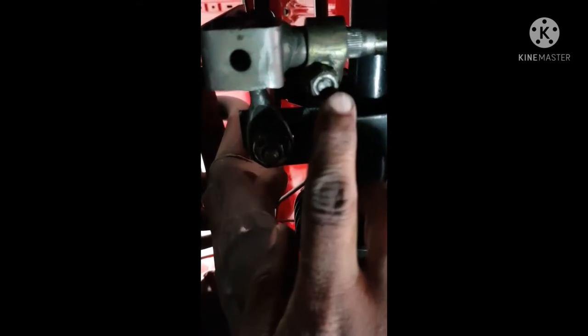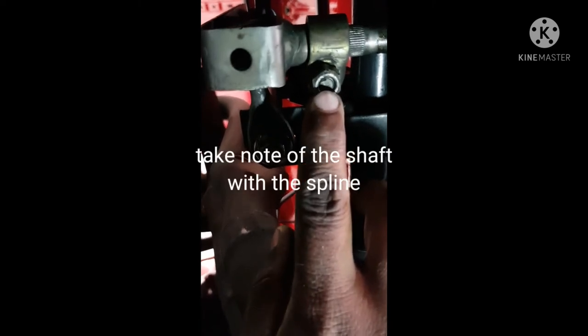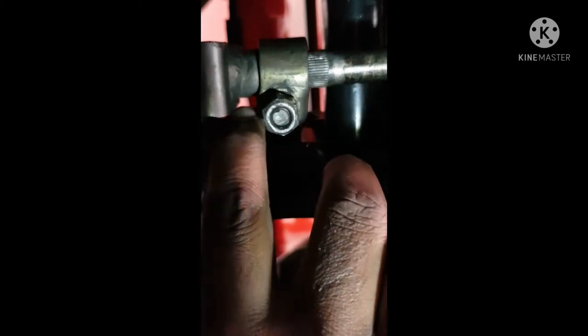The problem was my exhaust was right up against this, so obviously this bushing was heating up. And then that rod, as you can see, it's got a spline there — a 13mm nut and bolt. So you basically loosen this and you can move the spline, the shaft in and out, and you can actually turn it clockwise or anti-clockwise. That then goes into this little box here.